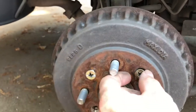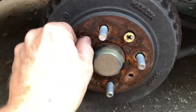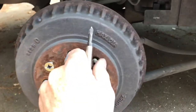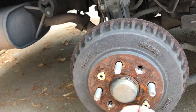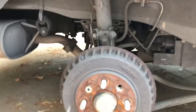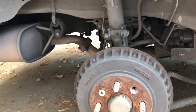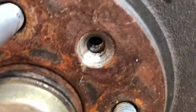I had to go buy two other screws that had heads on them so I could actually use a ratchet, because these were not easy to turn by hand. If the drum won't come off with a hammer, a regular screwdriver is not going to have enough torque. Now we've got this thing in and we've got leverage — turn a couple turns, turn a couple turns. You'll notice there's a gap between the screw hole and the spindle getting wider, which means it's working.